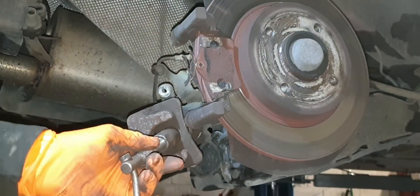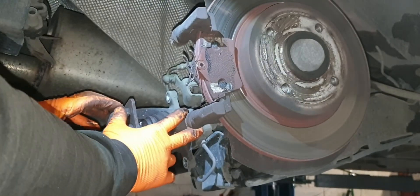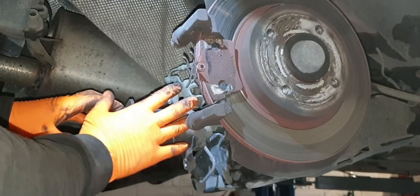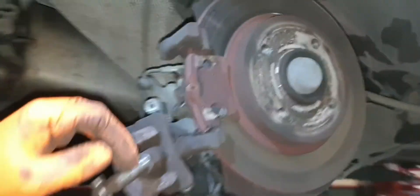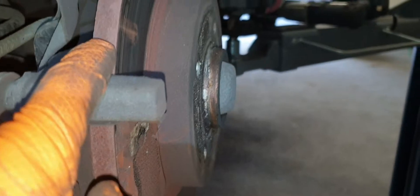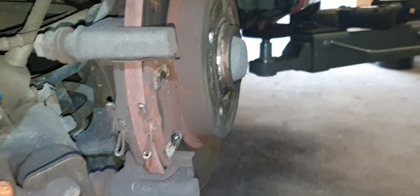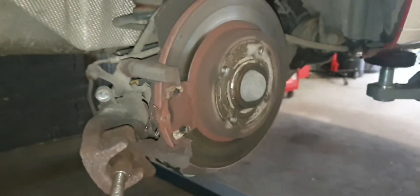That piston is toast. We're going to fit a new brake caliper — a reconditioned one — and the old one will go back to be reconditioned and end up on another vehicle. We're also replacing the brake pads on both sides as they're down to their minimum. We measured the disc and it's good, so just brake pads on both sides and the caliper on the driver side, and this car will be good to go — no more binding, smelling, or running hot brakes.